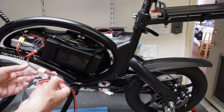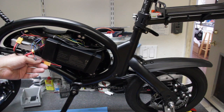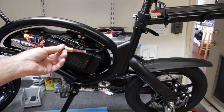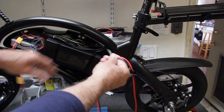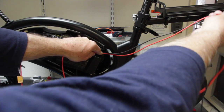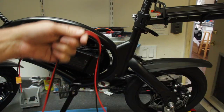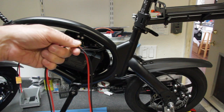Take your set of wires from the controller. We're going to route the wires either underneath or on top of the battery depending on what gives the best spacing — we'll run it above or below. You want to give yourself enough wire to go through this connector space and a little bit extra, because you can always tuck it inside the bag. Run that up and size it out so it will tie in to your battery. Once we have that we can cut the wires, and I'll show you how we're going to solder these connectors on.